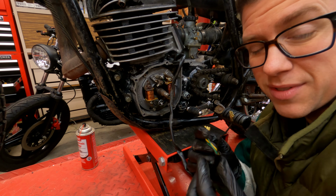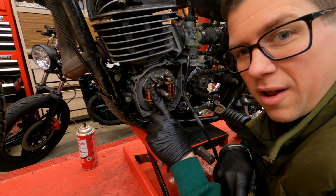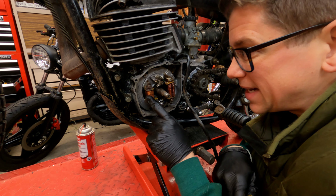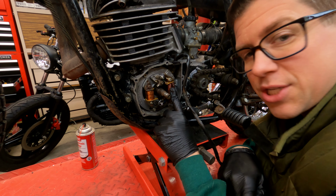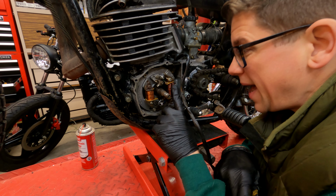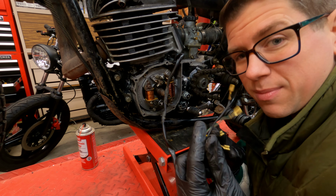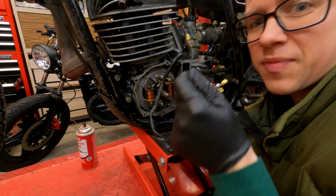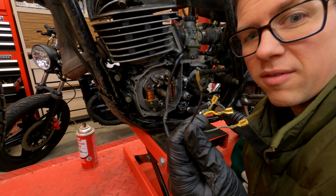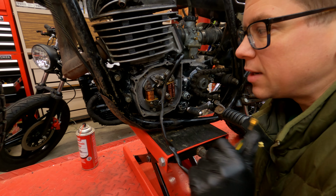And the main essentials is pretty much just this black wire. These two coils, the small one on the left is the lighting circuit. This right one is the ignition circuit. So the ignition coil, the lighting coil. The black wire should come right off of this ignition coil, and we should be able to run this right to our main ignition coil for the spark plug. So it'll be pretty easy, hopefully, and we should be good.